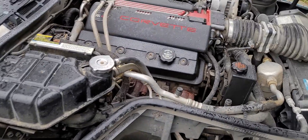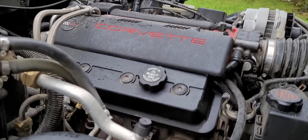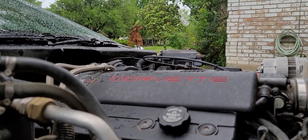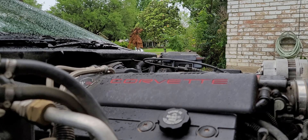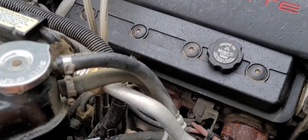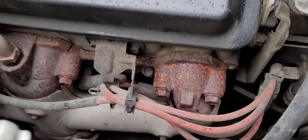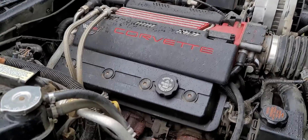We went ahead and replaced that, but I figured I'd talk about the whole system. This is a pressurized system and its sole purpose is to allow the car to operate at a higher temperature setting. What it does is raise the boiling point of the coolant. Under a 15-pound system, the coolant will not boil over until around 262 degrees. Of course, if you've got a failure in the system - like I had where it was letting air in - that's when you get those kinds of boilover problems.